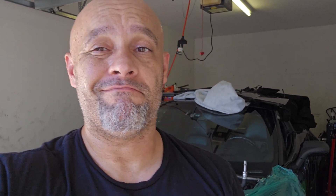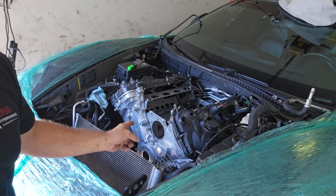I need this done ASAP — I don't like waiting around or taking months on things. I'm selling the LS9, the Kong port injectors, everything that had to do with the motor on this car. I am committed to Coyote-swapping this car. The spacer can get made, motor mounts fit, headers will fit — it's just a matter of a control pack and wiring, which some people have said they'll help with. Motor mounts for the LS9 fit the Coyote — thanks for listening, talk to you later.